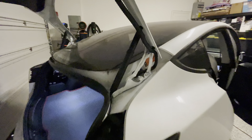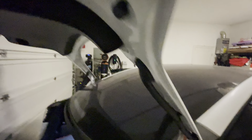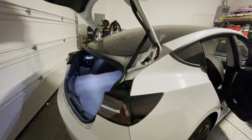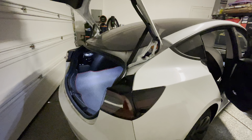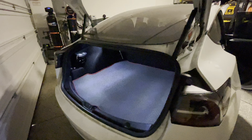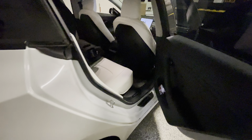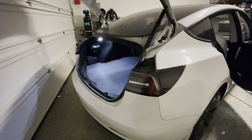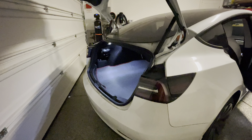The most challenging part was fishing the wire between the actual trunk all the way up — that was the most challenging — but with a lot of lube and Vaseline, you should be able to not have any issues. Definitely watch the video before you install it. There's a lot of wires to run along the trim, lots of panels to take off. You have to tap into your 12 volt underneath the rear seat. I think it's well worth it and something you can do yourself — it's not challenging, just tedious.